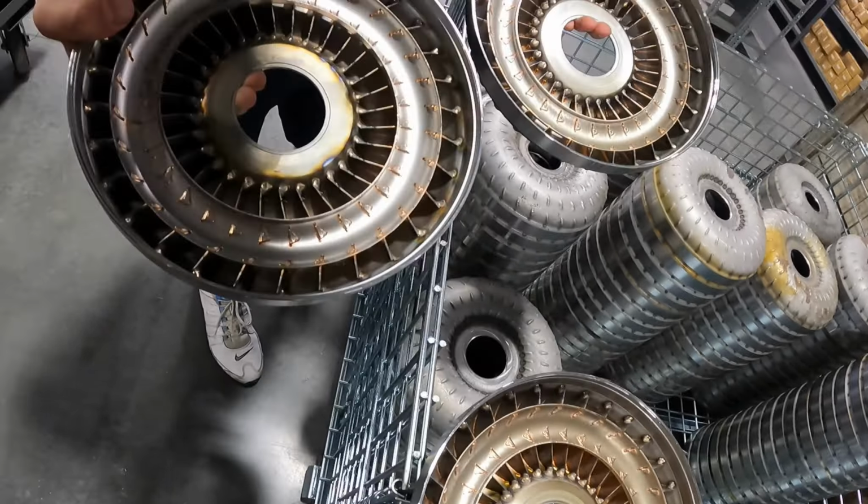Oh, wow, that looks like a whole lot more. Yeah, so the inside blades are a little different, and the outside blades, where it exits, is going to be a little different, which will give you a different stall speed. So which one will be a higher stall? This one? Yeah. So that one's like straight, and then this one's really at an angle. That's pretty cool. That's rad. Yeah, so that combined with the diameter size.